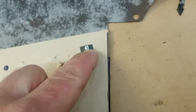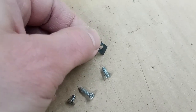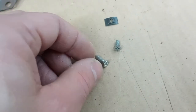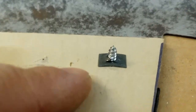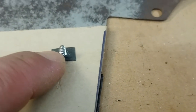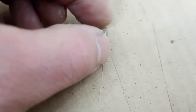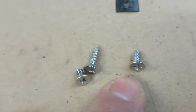I needed to find a nut that would be nice and flat, and I found these — they're called flat nuts or stamp nuts. I'm using number six sized screws, 6-32s. I started with sheet metal screws — you can see that's pretty long, that's too long. Then I tried half-inch, then quarter-inch — quarter-inch came up too short, they didn't come through far enough to engage the threads on the nut. So I found some 6-32 machine screws, 5/16ths of an inch long.